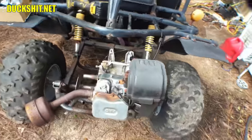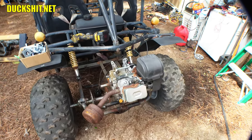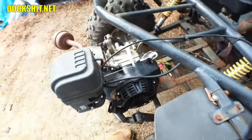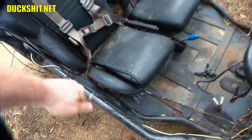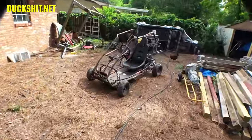When I tried to get it started for one of my friends, I just could not get the thing to spark. It was starting to get dark so I gave up on it. Today the goal is not only to get it running, but to get it running right — idling properly and revving up via the throttle. It was missing some throttle linkage, so I made new pieces that attach to the governor. The throttle cable is rusted solid, so all that can come right off. This is all garbage — terrible wiring with electrical tape wrapped around everything.